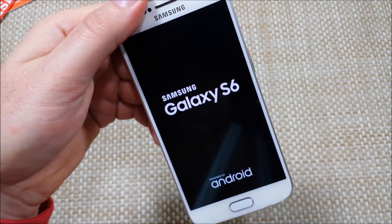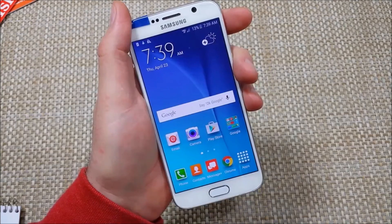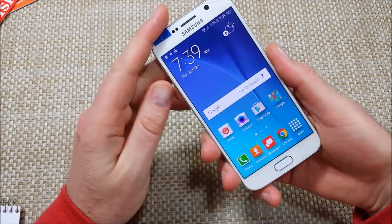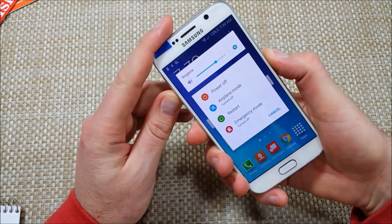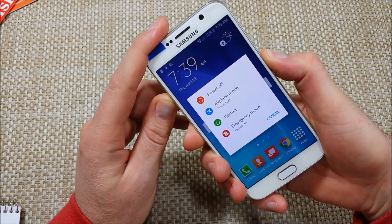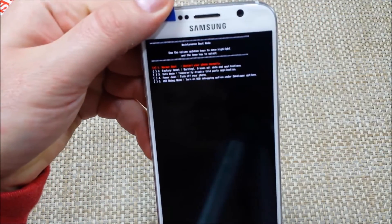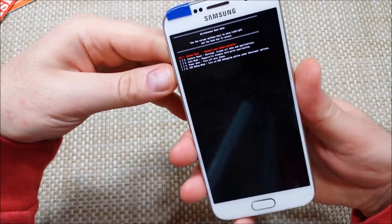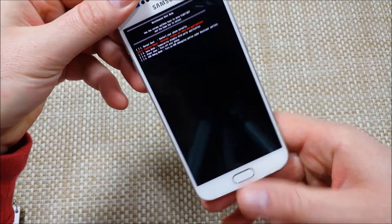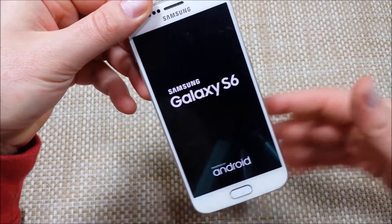Now I'm going to show you the other way if the phone is turned on — it's not the menu option, it's a secret way. So the other way to reset your phone is if it's on, you're going to press and hold the power and the volume down key and keep holding it for about 7 to 10 seconds. Now you're in your maintenance boot mode screen. You pick number two to scroll down for factory reset, and if you hit the home key it actually starts to reset — you don't even have to pick yes or no. It just does the hard reset this way.